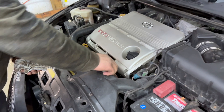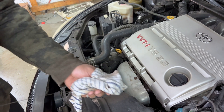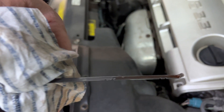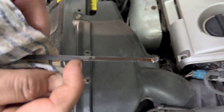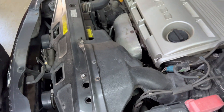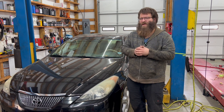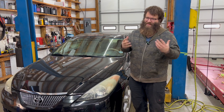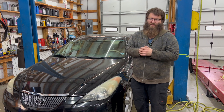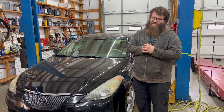Last thing to do is check your transmission fluid level — you can do it hot or cold, with the engine running. The line is just right there below the hot mark, so fluid level is good. If you need to add any, it is T4. This CV axle repair is pretty standard and very similar across the board for most front-wheel-drive vehicles. The center support bearing did give a little extra trouble, but it's not the worst. This part costs about $150 to $200 depending on where you get it, and about an hour and a half to two hours of your time. If you liked what you saw today, like, share, subscribe — thanks for watching.